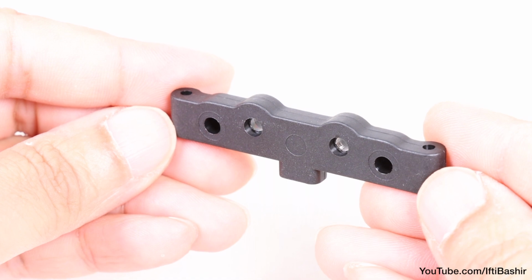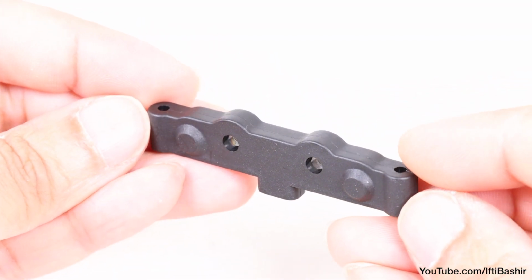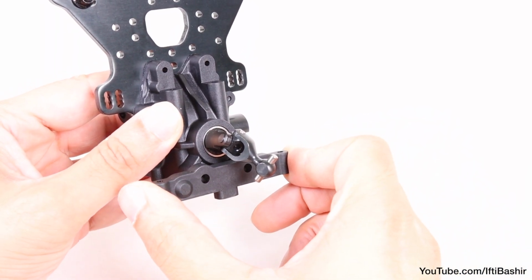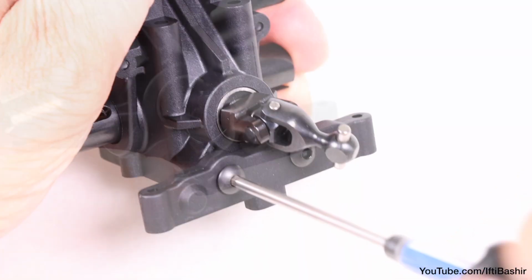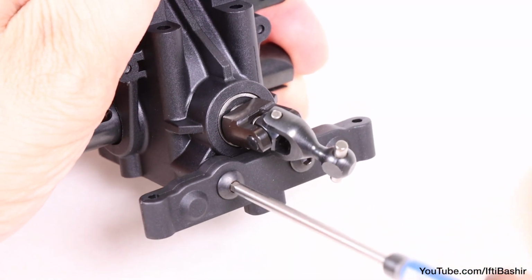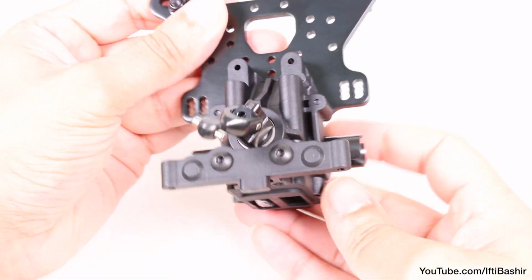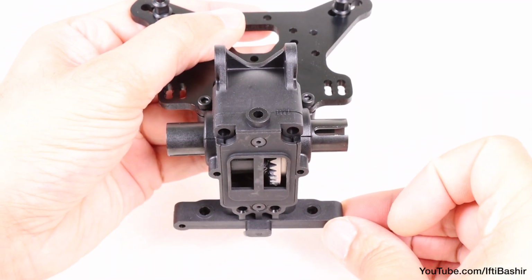Plastic in construction and no inserts to install here either, so little by means of customizability, although that sits straight onto the rear gearbox just under the rear drive shaft and is secured with two 14mm button head screws, again only until snug. Double check orientation here, the two outer holes should be facing inwards towards the gearbox so that the hinge pins can sit inside.